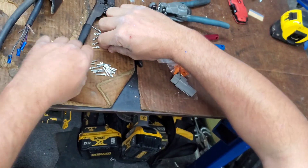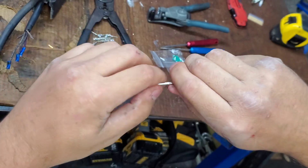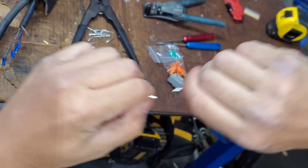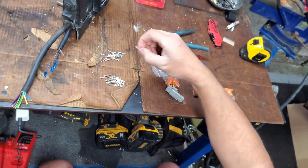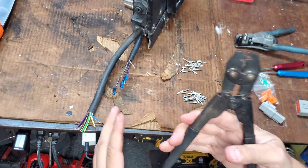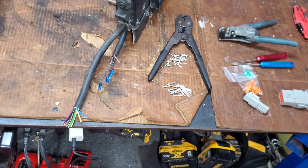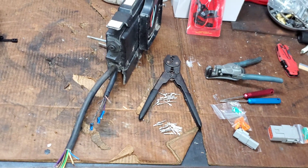We've got our 12-pin, our 3-pin, and all our pins here. These pins are a very tight fit and it takes a little to push them in, so you know you're going to have a really great connection. You have to have a special set of pliers — technically you don't have to because you can just mash those tabs over, but we have these special pliers made for pushing these connectors. I've used Deutsch connectors on race cars, on my boat, on my four-wheeler — they are a waterproof connection.